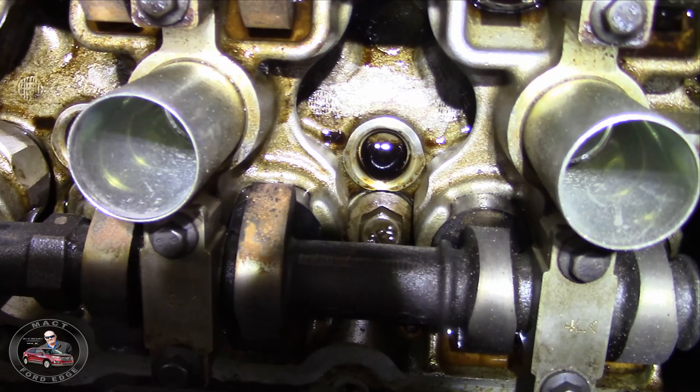We're probably going to go with another Motorcraft alternator. The cold air intake — I'm in the air about it. I don't know if we're going to go with the factory intake or do a cold air. This is for my daughter, so I'm thinking ease of maintenance for her. The battery — we don't know what the battery is or the date on it. We can't find the sticker. But it's a NAPA Legend battery and it's testing out around 910, so so far it's checking out pretty good. We'll stick with it until it gives us anything differently.